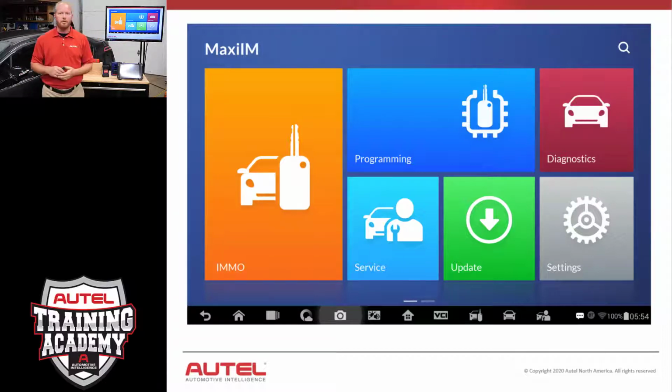You push the green button. And I'm going to tell you right now, these tools update about every week to every 2 weeks. And the number one call to my tech support line is, this function doesn't work. And did you update your tool? No. They update the tool and now it works. So keep your tool updated. It's as simple as pushing a button.